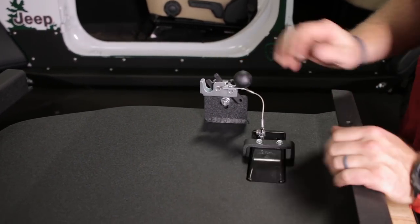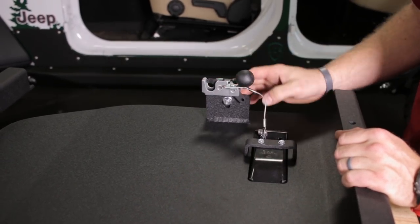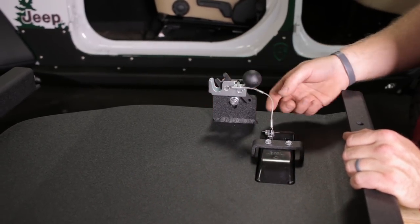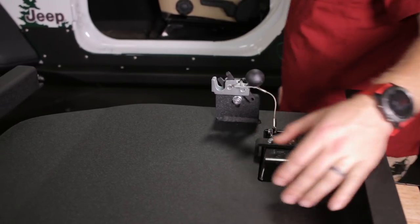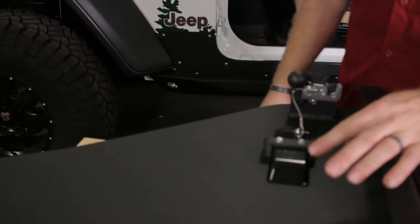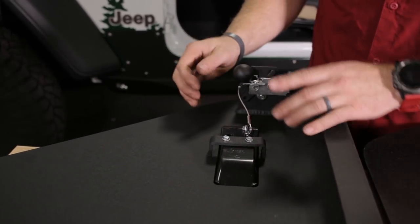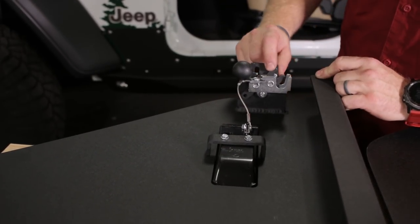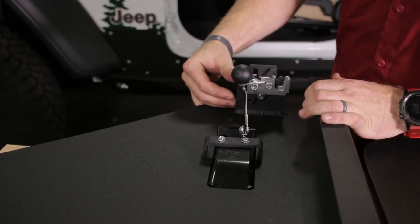So that's for the front door: latch opening facing down, on the forward side of the mount, and cable lugs squeezed tightly between their mounting points. On the rear door, the hinges assemble the same way and this assembles the same way, except the paddle lever is on top. On the front door the paddle lever is on the bottom, and the latch is mounted so the latch opening is on top as well — kind of upside down compared to the rear door.